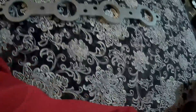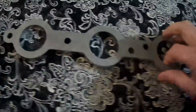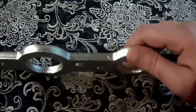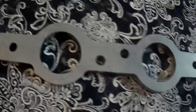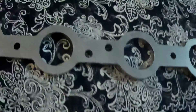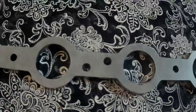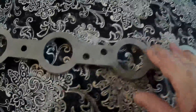So that's the 1.5 inch long radius 90s. Up next we have our flange — this is an exhaust flange, and this one is also stainless. I had this laser cut at work. It's 304 stainless as well, and I'm going to cut it right through here so that it can expand and contract at different rates. The factory manifold split right there also, so I think I'm going to split it there.